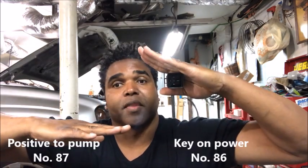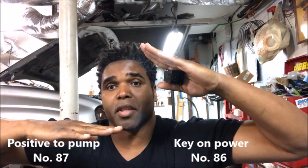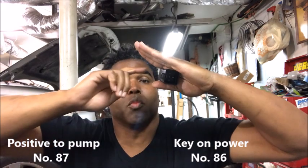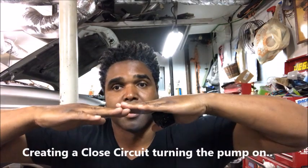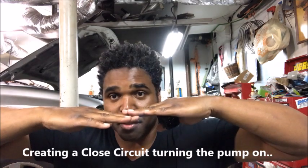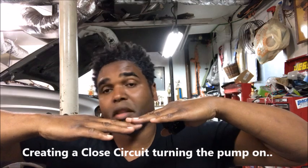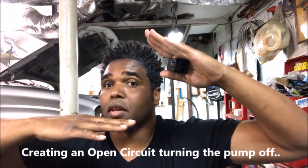What this will allow me to do is — the car is off, so let's say this is the electricity, and it's an open circuit at this point. I'm going to turn that key on, and with this relay and the magnet, it's going to cause this to come down and make contact. Now this is going to be energized, which is going to be the pump, so the pump is going to be on. Until I cut the car off, the magnet's not going to be energized any longer, and what's going to happen is the spring's going to pop it open and it's going to turn it off.